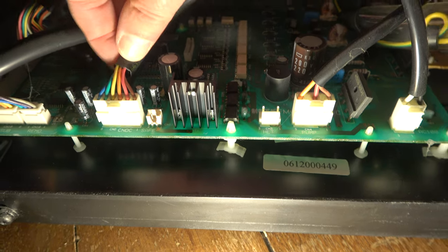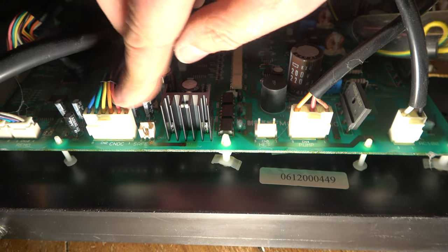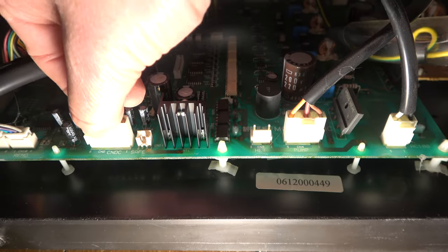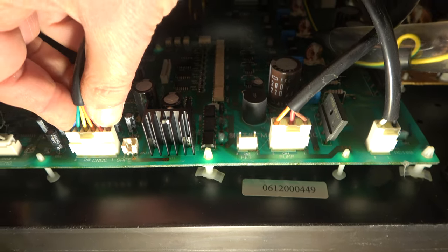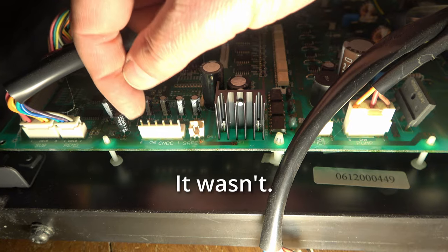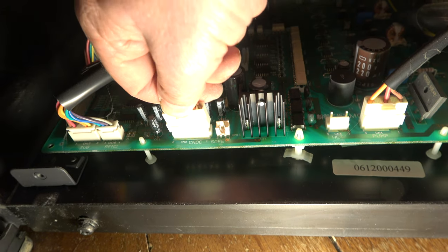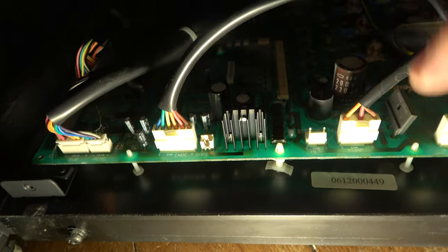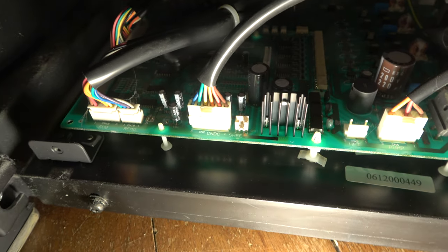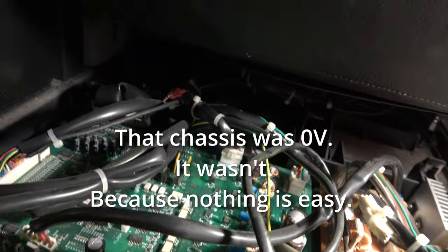The colour coding is non-existent. They've kind of done it in rainbow colour fashion. So there are no clues there as to what voltage might be what. That's a shame. I'll have to work out which one's ground. I could do that by unplugging it and seeing which of these are connected to the chassis. I suspect it's that first pin there, which is actually pin 8, but there may be others. So I can see what looks like a ground plane in there. Let's do some measurements and then look at voltages on here. If there are voltages on there, we're probably in trouble because it's not going to be a relatively simple power supply problem. All right, let's make a few DC measurements. Right, I'm going to make the assumption that ground is 0 volts.